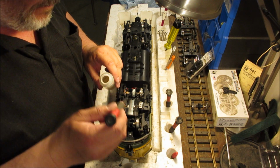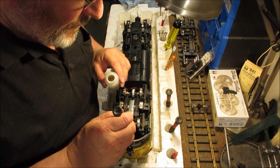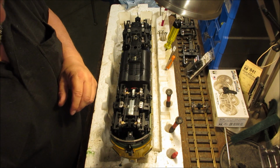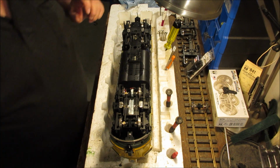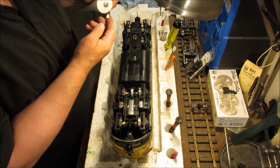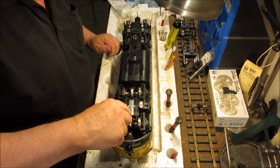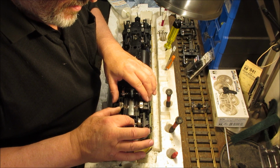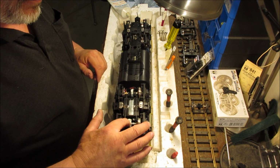We'll oil up the front bushing, like so. Okay, make sure everything is engaged, and it is. All the flanges are nice and flat. We'll grease up the front axle. Just remember, sometimes too much lubrication is worse than not enough. And that'll spread out amongst the gearing.